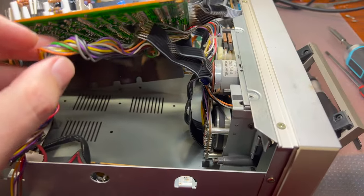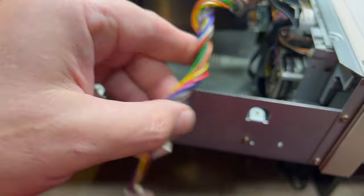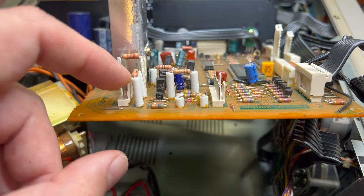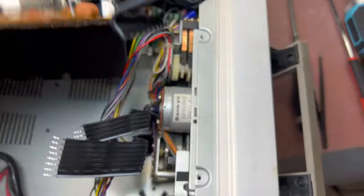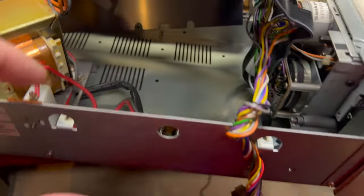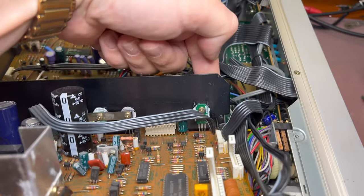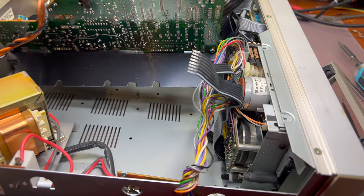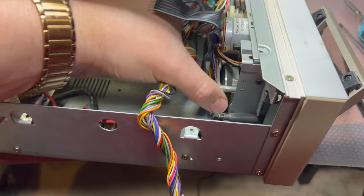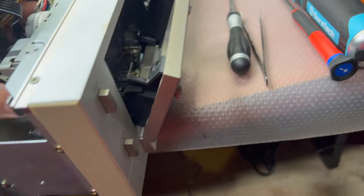In this part I'd like to show you how to remove the tape transport. I disconnected two connectors from their sockets and removed two flat cables which go to the tape transport, then pulled out two screws on one side and two on the other side, to be able to pull up the power supply and control board. Now I'm able to pull this tape transport out from the back because it just cannot go to the front.